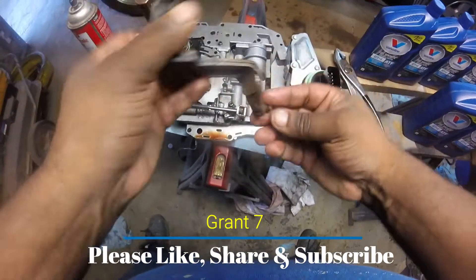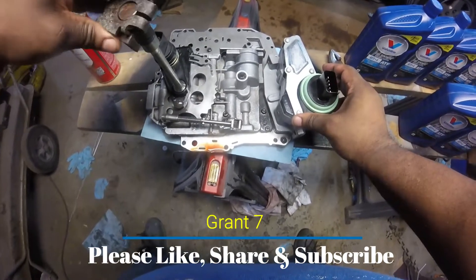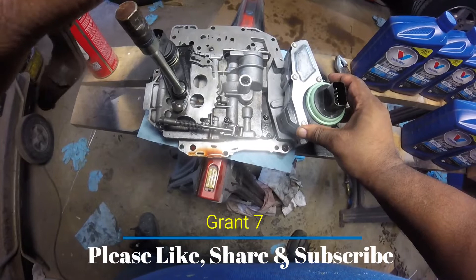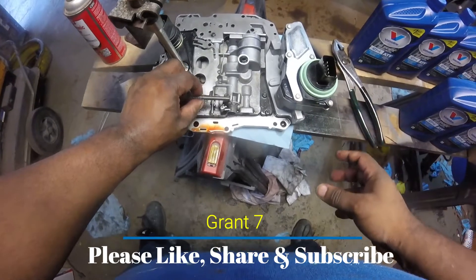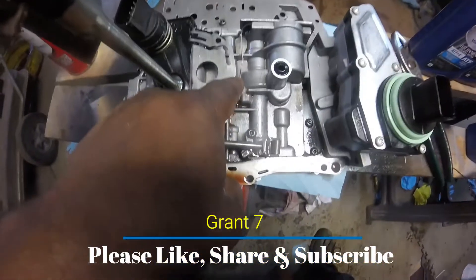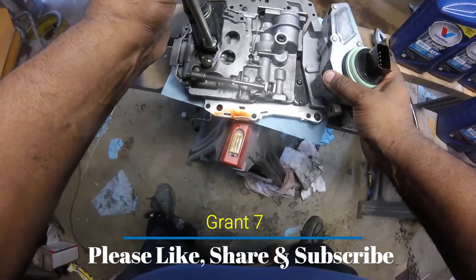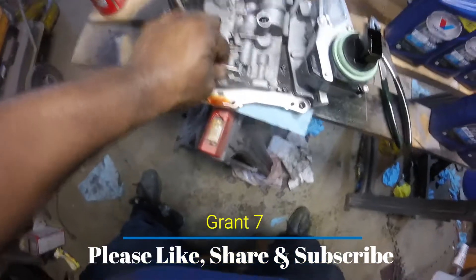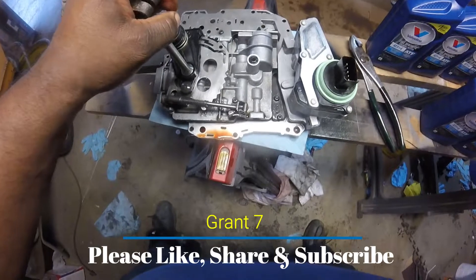So like I said: take the cable off — take the shifter cable off — put this back on, make sure you've got it in the right position. This will be laying loose anyway, so the only thing you want to do is go to that one last notch. You can't see this from the other side, so turn it one more time past low and it will lock this in place. Now it's locked and won't hang up on anything — then you can pull the valve body right down.